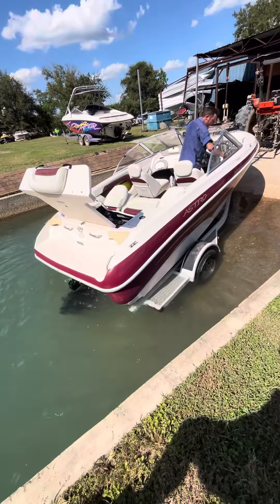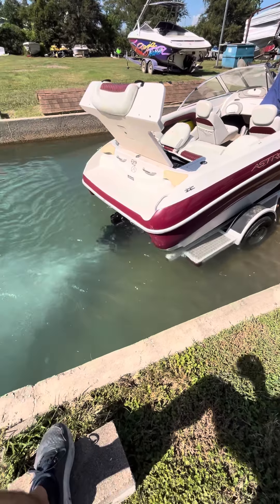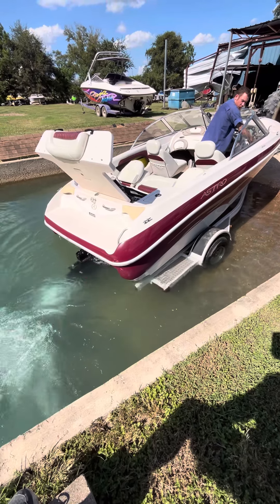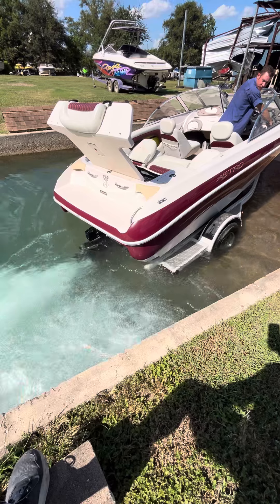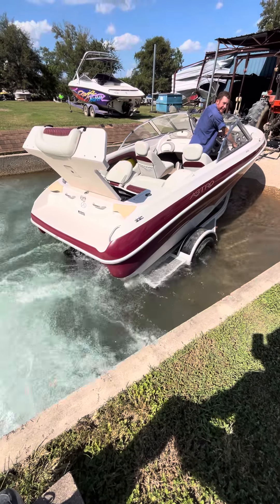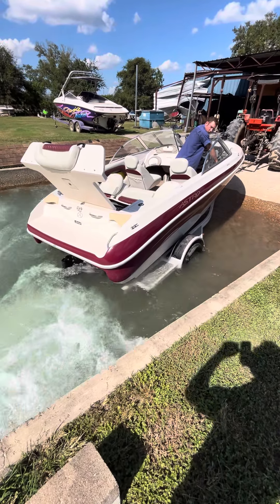Alright, put it in gear. Well, it didn't die. What's the RPMs now? About the same. Okay, bring it up slowly. Sounds like carburetion right there. Let's try that again. The carburetor's acting up a little bit. It's smooth and quiet back here. Let's don't — hey Mike, let's don't full throttle it, but we're going to bring it up a little. Sounds good. Alright, bring it up a little more. Sounds like it's got plenty of power. A little more — there it is.